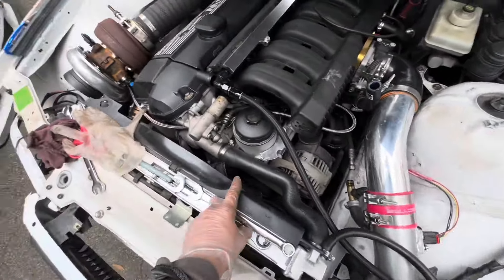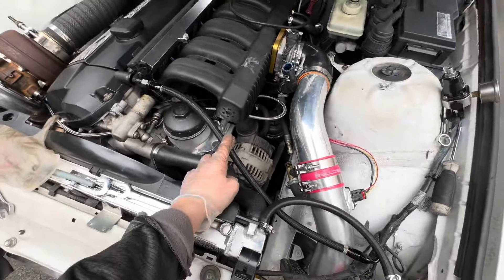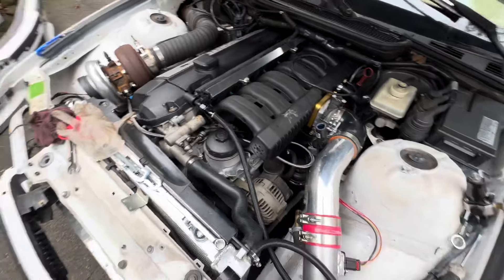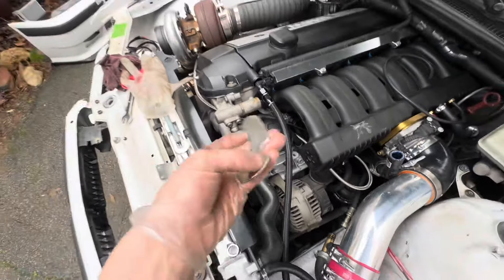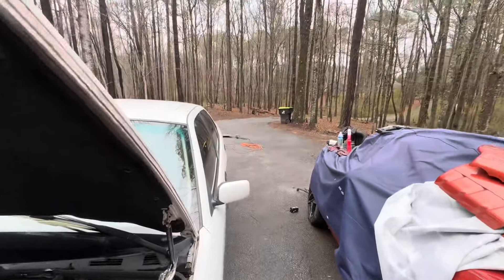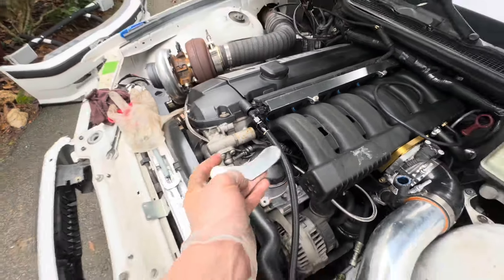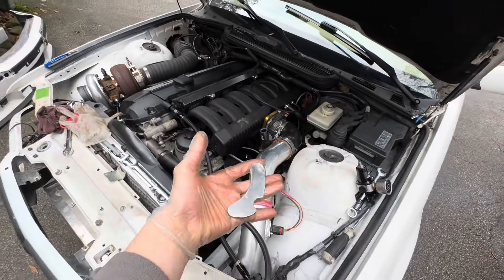Ended up deciding to mount it here on the oil filter housing. I'm going to have to shorten this AN line or relocate the fuel pressure regulator like I wanted initially, but the charge piping is too close right now so I got to get the charge piping redone first. I figured I'd temporarily cook this bracket up - it fits around the oil filter housing really nicely, just cut out of that big sheet. The fuel pressure regulator will sit right in this notch since the line drops out of the bottom of it.